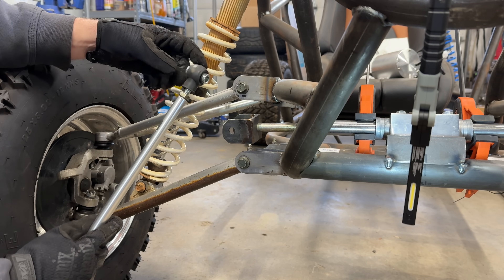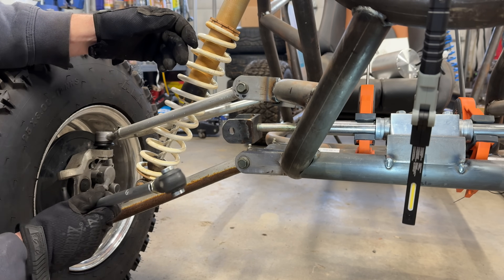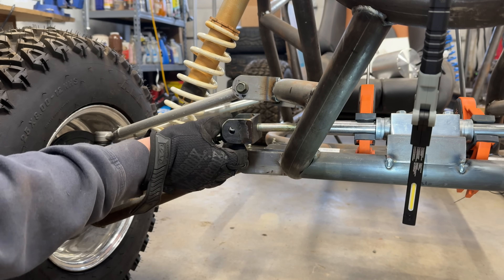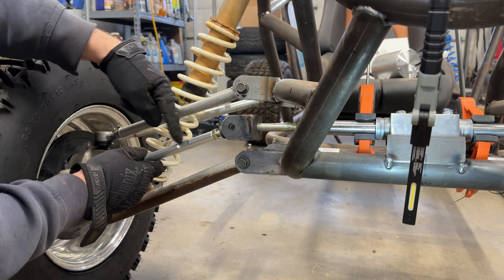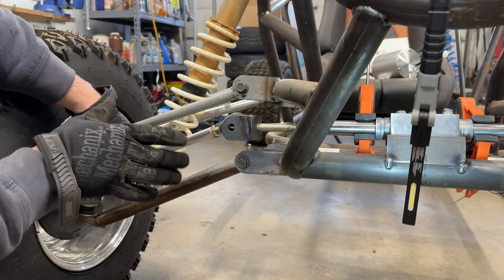I just got a set of tie rods and cut 15/16ths off at each side. Not bad at all. Now we have the adjustment of the tie rod, but adjusting the tie rod does not get rid of bump steer — that's a common misconception.